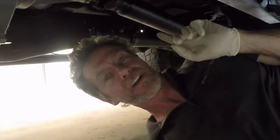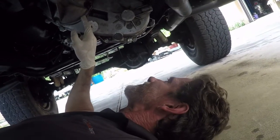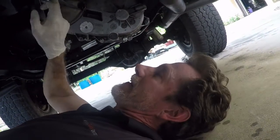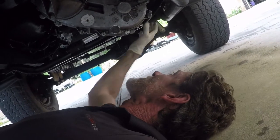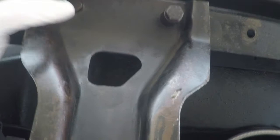I finally got this thing together and running and it runs great. The transfer case is back together now with new bearings for that main shaft, and it feels really, really good. It's leaking a little bit around the seal but I can replace that anytime — just pull the drive shaft off. I moved this cross member back one hole — just pushed it back one, drilled a couple new bolt holes in each corner, and re-bolted it. Here's the 4L80E installed.